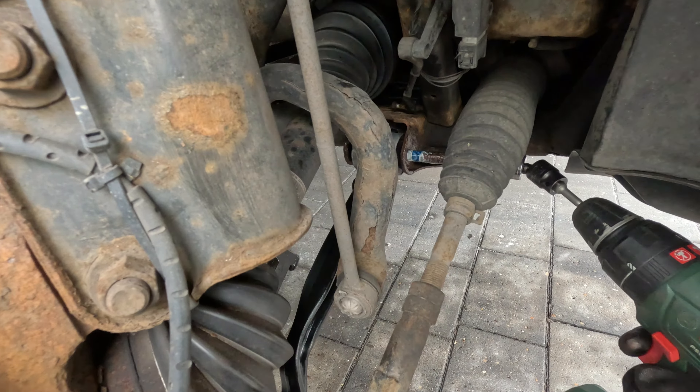That's 165 and now 90 more degrees. I'll make sure the other side doesn't turn while I hold here. Now we tighten this nut to 80 Newton meters, but we can't put a socket on it so I can't use a torque wrench. I know how 80 feels, so I'll go for it — though it's actually a bit over 80.